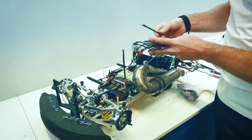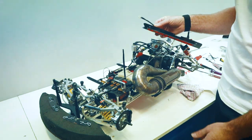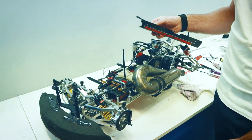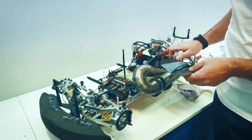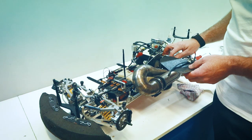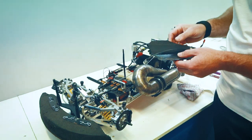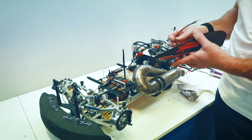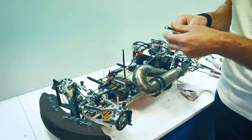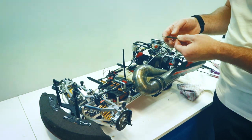This is Vitaba's high range sensor. I think they do two models. One goes to about 60 degrees and the other goes to well over 100. These Zenoah G230s have good running temperatures, just a bit over 100 degrees Celsius, so you need the higher rated one if you're going to do it. The higher rated one doesn't look like that. It comes in a bit of a band that goes somewhere, but it's a bit of a pain in the ass.